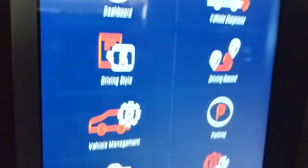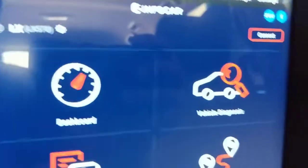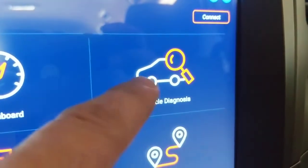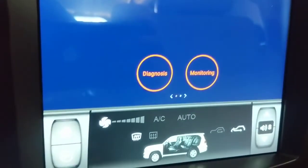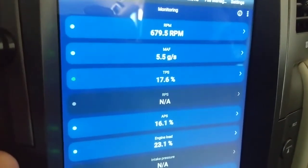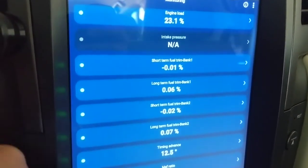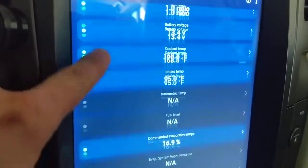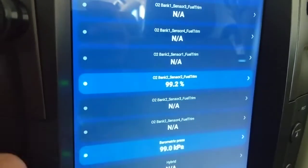From here you can go to a few different options. The useful ones most people will use: Vehicle Diagnostics — you can run a scan and if your car has any codes, hit the Diagnosis button. The Monitoring button shows you all the different outputs with the car running: your RPM, MAF reading, throttle position sensor, engine load, and all kinds of data that the OBD2 connector can read off this particular vehicle.